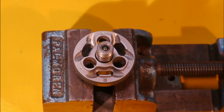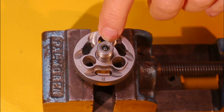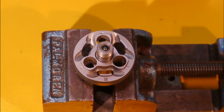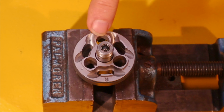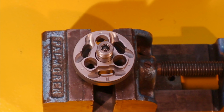So what they've done, instead of having ports that are out as far as you can get them, which is the way you want to design a piston. All good pistons, all Ohlins pistons have the ports out as far as they can, especially on the compression side. This is the rebound side, and they've just drilled the holes out, and you can see it's very thin in here. Why didn't they go out? So then, this particular shock, I think the Ohlins we have just in shims, just regular shims, not ring shims or slotted shims or any fancy shims.